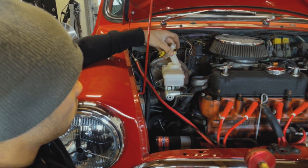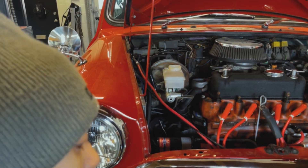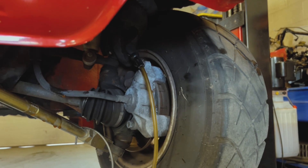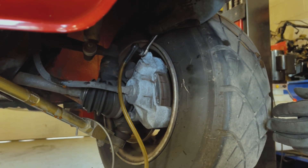And we're draining the brake fluid here. To drain the brake fluid, we find it easiest to use our pressure pump. This way we don't have to have someone sit inside the car. So we pressurize the system and then crack the bleeder.